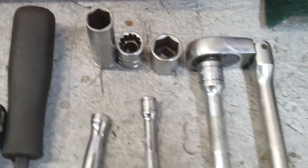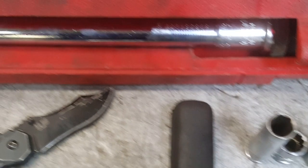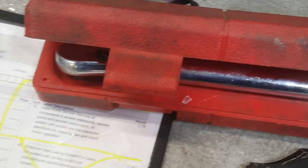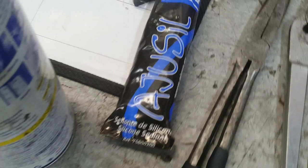Further along in the video I'm going to show you the torque sequence and torque specification for this vehicle, along with the belt routing diagram — I'll have a picture of that up there towards the end as well. We're also going to be pulling a vacuum on the coolant system to get all the air pockets out. The reason we're replacing this water pump is because it started leaking from the weep hole — the customer was seeing it underneath the vehicle.